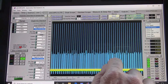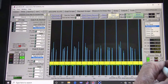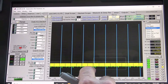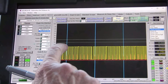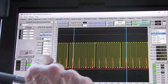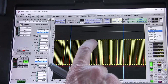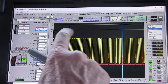Now what we want to do is come in and take a look at a couple of things. I'm going to move this trace down so it's easier to see. Now I'm going to get the zoom window and zoom in. We're also going to turn off the knock sensor for right now. This is the number one injector — let's zoom on that right here. So the yellow trace is our cam signal. I want you to notice that I have an opening at the top and I'm closed during the indexing point. On this indexing I'm high and then on this indexing I'm low.